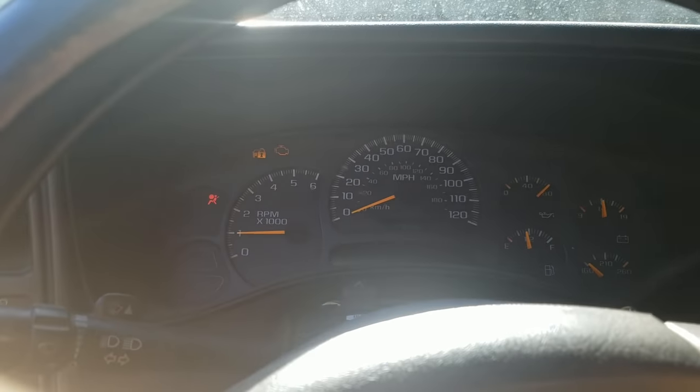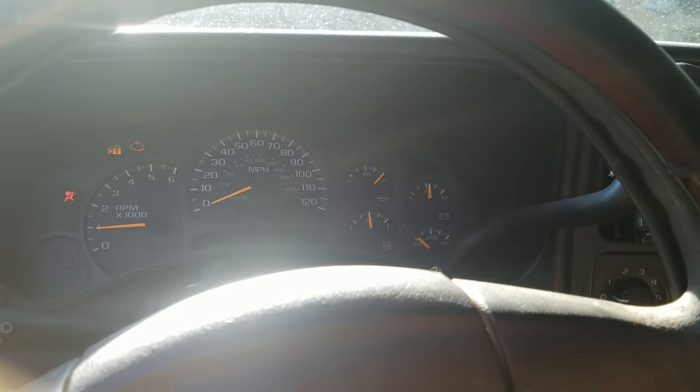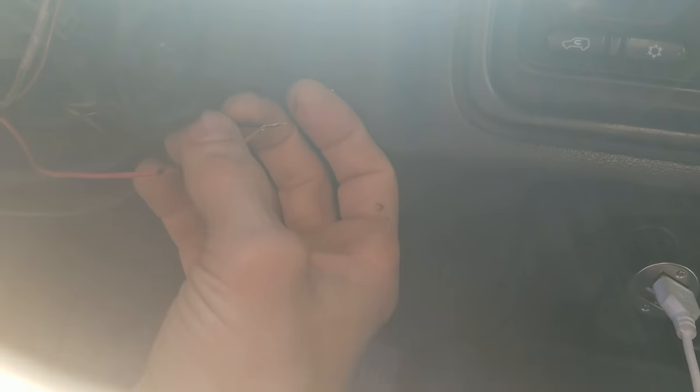The only downside is the security light stays on, but I really don't care for this truck. If you have a nicer truck and don't want that light on, you can either take the bulb out — which means pulling this panel and removing that bulb — or you can put a resistor between the yellow wire and the black wire. The problem is you have to know the exact resistance that was in the sensor from the factory, and that's very hard to determine because not every truck is the same. If you can figure out or test what resistance works to make that light go out, you can fix that.